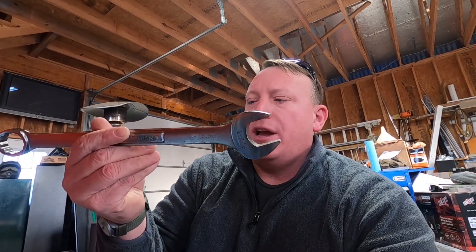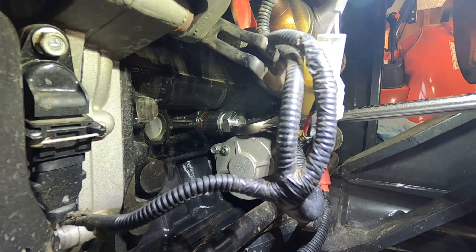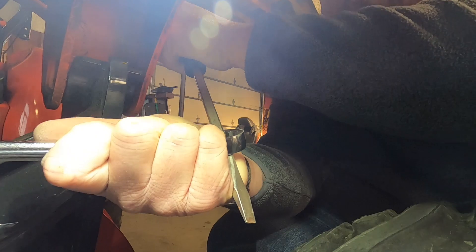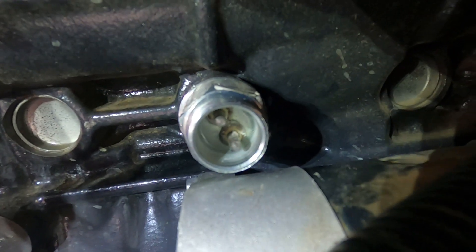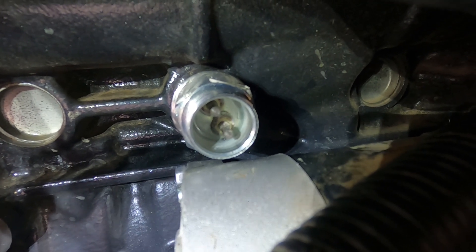Let's cover a couple of additional tools we didn't go over in the beginning. I ended up needing an open-end wrench — inch and one-eighth. I also needed a screwdriver for leverage. If you put it there in the middle, there's no room to get the wrench in, so I put it in straight on and used the screwdriver as leverage on this side to tighten it. Another thing to keep an eye on are the contacts inside the heater — if you're going to put it here, make sure they're oriented so you can plug the cord into the back side, otherwise you'll have problems.